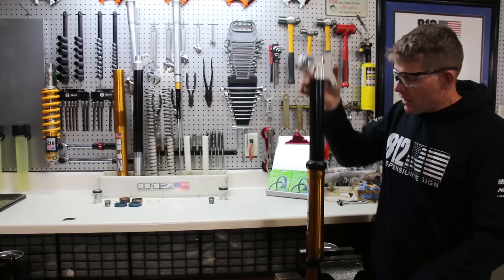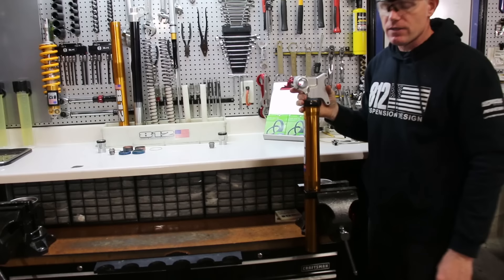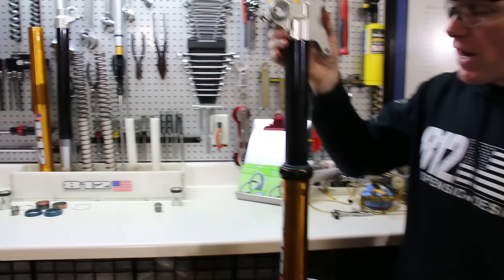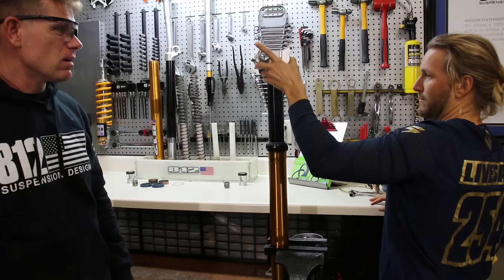Here is what right looks like. What happens is people torque it, then recheck it and torque it again, and what you've created is stiction and friction. This can be measured and it can be felt. The fork will not go past a certain point because it is stopping the inner and outer bushing from sliding through the top tube. If you didn't have it that tight, it would just fall down freely.